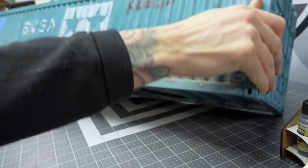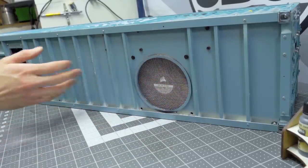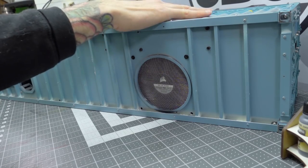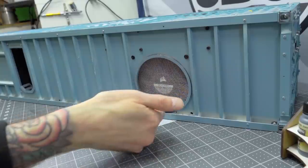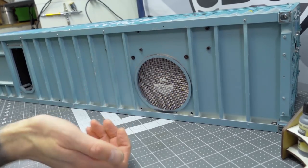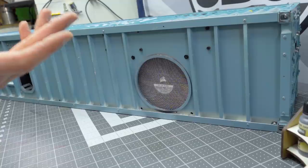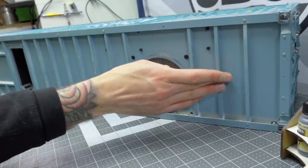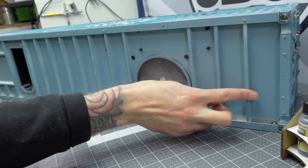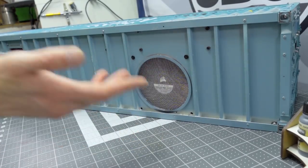I'm going to turn the whole unit on its side so you can get a better idea. Here you can see there is a fan for exhaust — this is the rear of the cage — and right in this area where all of these screws are is where the GPU is. The fans are pulling air off the GPU, and this fan works as exhaust to pull that air out. When it sits on the trailer, you get totally ample airflow. Will it work just sitting on a desk? Yes-ish — I probably wouldn't suggest it though. I could make additional cuts here to get a lot more air flowing outside the back of the case.